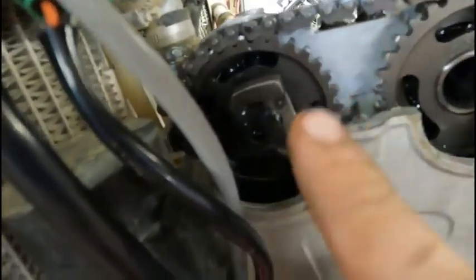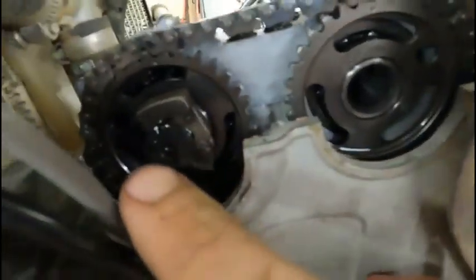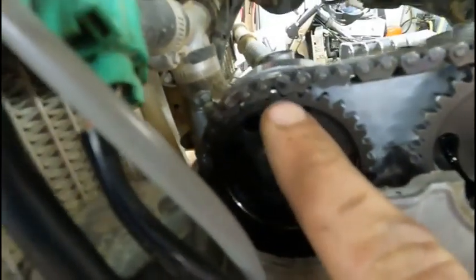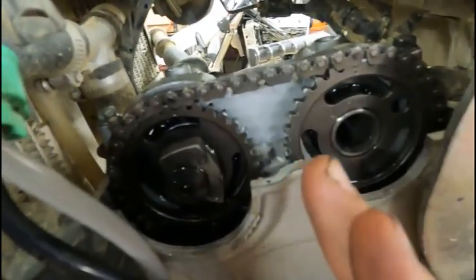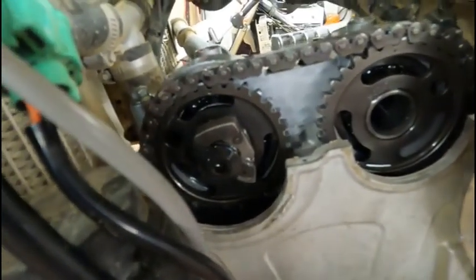So now I know when I line it up that the little pin marks on each side of the cam need to line up with the head. And then I need 10 pins between this dot and this dot. That makes sure that one's not off a tooth and I accidentally have 9 pins between the teeth, and it should work out pretty good.